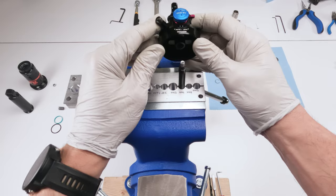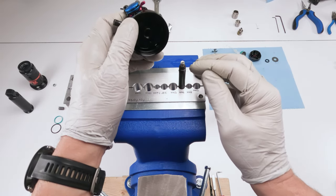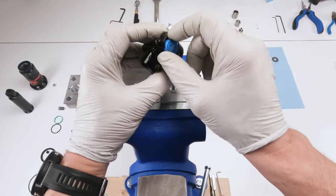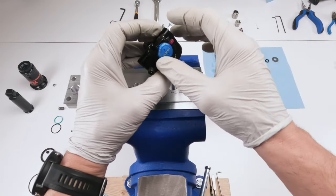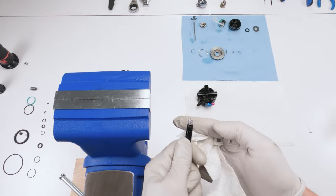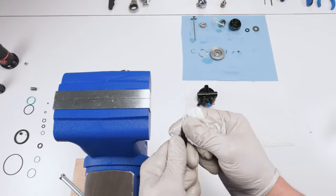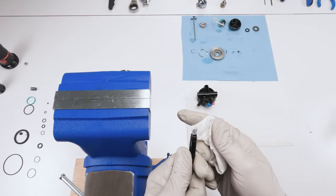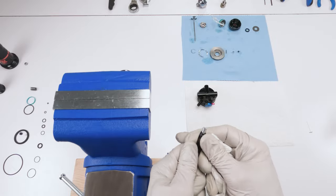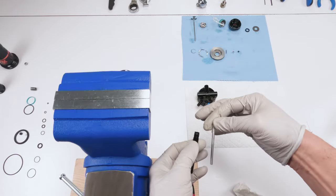That's very important for later. We'll go over that later. All right. Next, we will work on the seals inside the shaft before we remove the remote mechanism and work on the remote mechanism and change the spring. First step, let's clean any Loctite residue off the threads. Make sure you get all the Loctite off the threads. Do it now. Okay, see what I mean? So then we're gonna take the shaft from the inside and we're gonna pull it out.